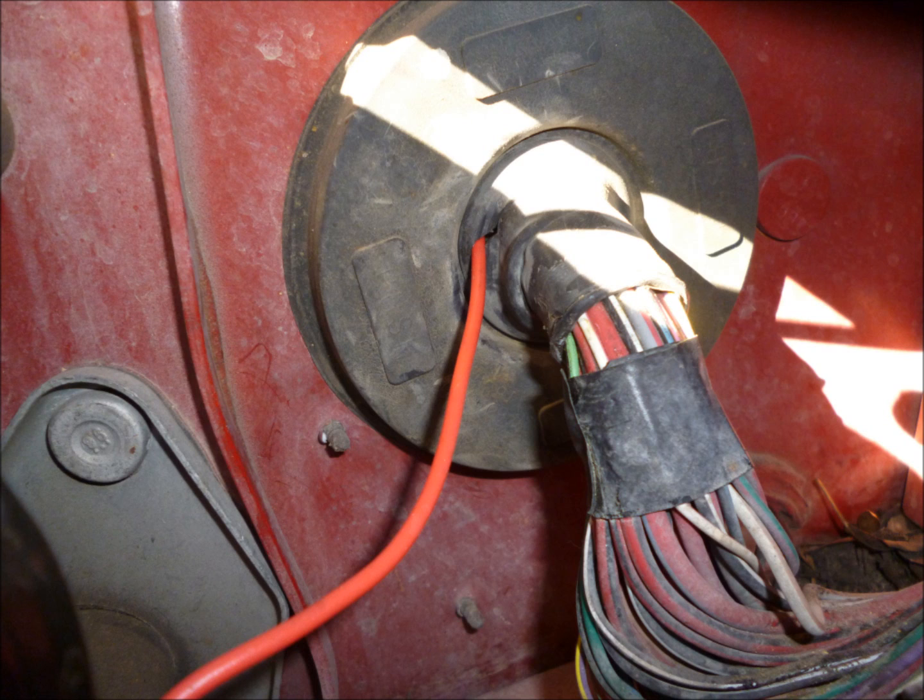You can try and run the wire in the middle of that bundle, but it's a whole lot easier to just poke a little tiny hole in the rubber surrounding where the wires come in, and just poke it in through there. That's going to make a tiny hole in the seal of the firewall, and if you ever go off a cliff and you're in 20 feet of water, you may have a slight drip coming in through that hole that we made, but you'll probably have bigger problems and not be worried about it.